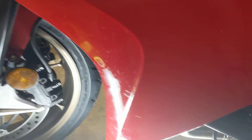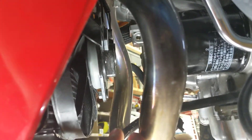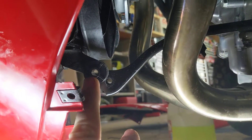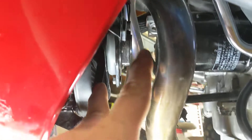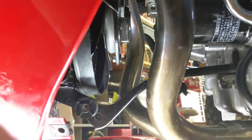What Honda wants you to do — and I've got to lay down to show this — is right up there is the oil filter. Without removing the lower brace of the radiator, you can't really get the oil filter through this spot; there's just not enough clearance.